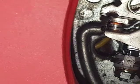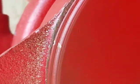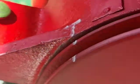That is the point — the spark's going to happen. It needs to happen when this is lined up with the mark on the flywheel, and then after that it carries on and you'll end up at top dead centre.